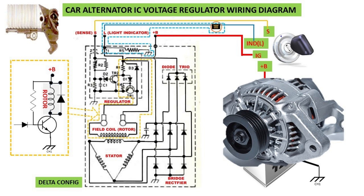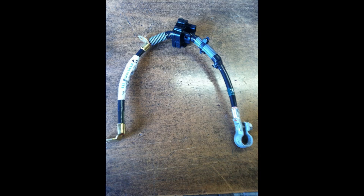There will be people that argue — this opened a giant can of worms on the forum. But on older vehicles, at least the second generation, it is very easily possible to defeat this system. If you look at the picture of the negative battery terminal, you'll see a weird-looking box attached to it. That is a sensor which tells the engine controller how much power is being used by the vehicle. Everything is grounded to the chassis, and then back through the battery is this heavy battery cable with this sensor installed.